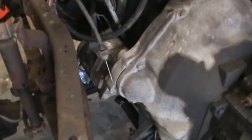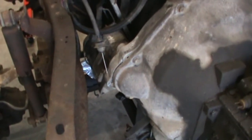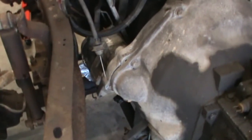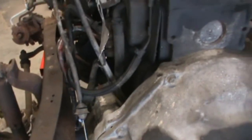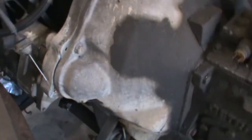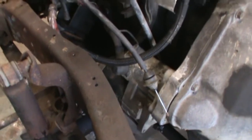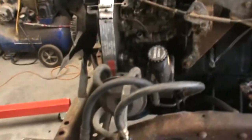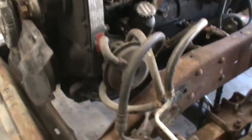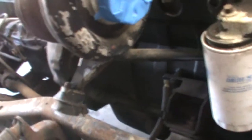One of the reasons I wanted to wait until I took the frame off is so I can give you guys a good visual of what's going on. There are actually eight 14-millimeter bolts to hold your bell housing to the adapter plate, and then if you have a manual transmission you'll have to remove your slave cylinder — there's one bolt back up underneath there. I'm also going to remove the starter and all this throttle linkage, and remove the wires to get some of this stuff out of the way.